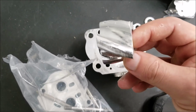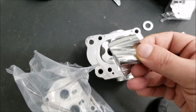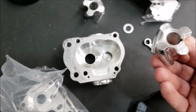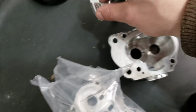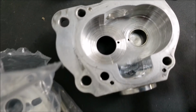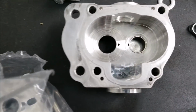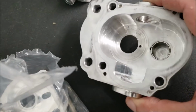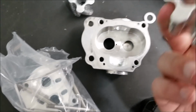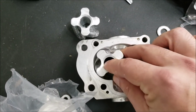These are lobe design rotors, aluminum on aluminum, which kind of works against you for longevity. You know, it's billet. Everybody's all fancy about billet. They think billet's like the best. You know, billet's pretty cool. But the problem with billet is that although it's stronger and denser than porous cast aluminum, it's still aluminum. And so unless it's billet steel, being that it's aluminum, you've got an aluminum lobe and you've got thrust wear pushing this aluminum lobe against this aluminum housing.